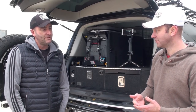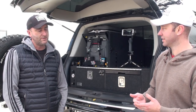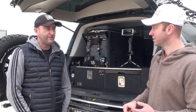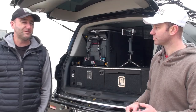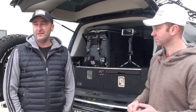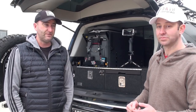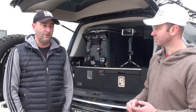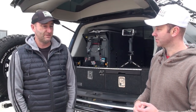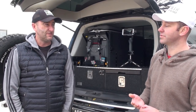Anything done under the bonnet? Full Pacemaker headers, exhaust, and a Unichip. Did you notice a difference? When I put the 35s on — the original BFG 35s, which are quite a small 35 — I didn't notice a difference in power. But then when I put the Nitto Ridge Grapplers on, which are a true 35, it bogged down a bit, especially climbing. The Unichip sort of overcame that — it just brought it back to what it felt like before, which was very interesting.